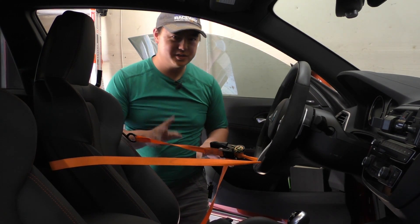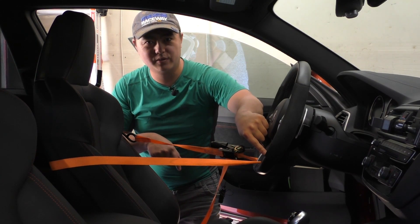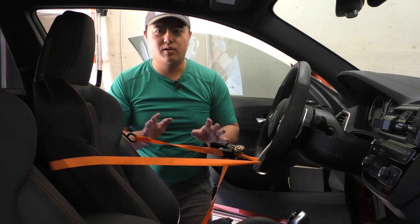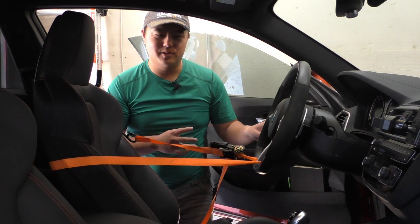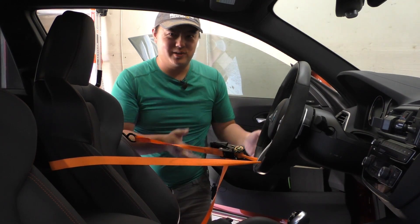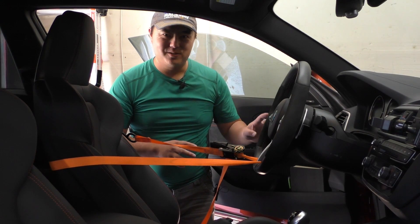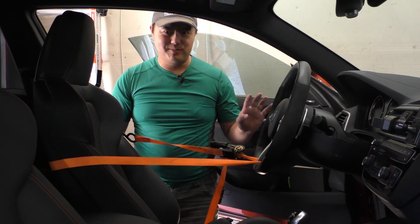After getting the car in the air, the first thing I want to do is center the steering wheel and then lock it in place. You can see I've done that here with this ratchet strap, gone around the lower spoke of the steering wheel and sent it around the backside of the seat back. The reason is that when you disconnect either the tie rod or the wishbone or lower control arm from the knuckle, you can throw off the steering massively — the tires won't turn where you expect. I recommend having an alignment scheduled right afterwards and making sure that alignment shop is close by, not on the freeway, because you can make this car very practically dangerous to drive.